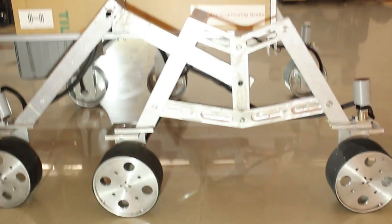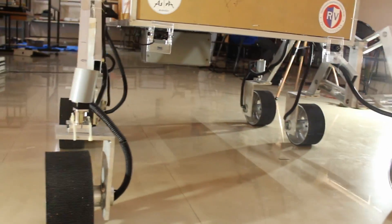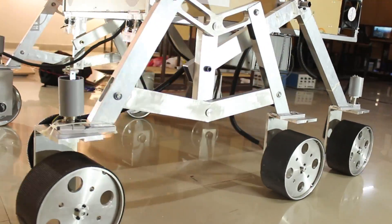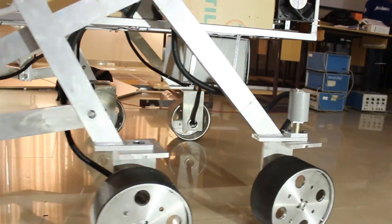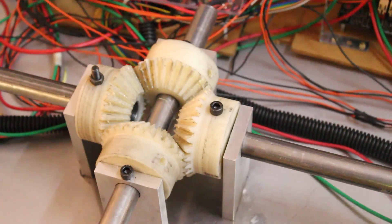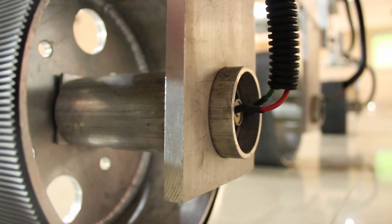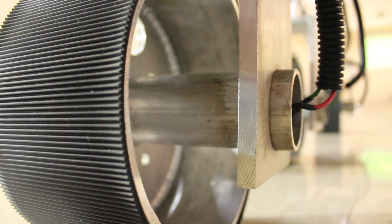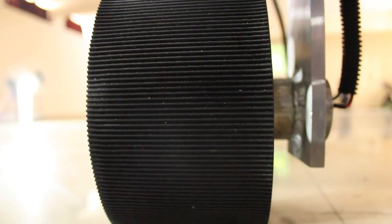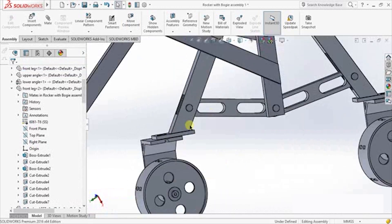For the chassis architecture, we employed the double lambda implementation. We used commercial grade aluminium of 6000 series. The entire chassis was built using rectangular hollow shafts and slabs. The hinges and linkages have been strengthened with tempered steel and small bearings. We have introduced an N differential into the system which uses 4 bevel gears. The motors are housed inside the wheels, enclosed with aluminium sheets for protection from rugged terrain. The wheels are ring rolled with a diameter of 200 mm and covered with rubber mouldings to improve traction. The entire design was made using SOLIDWORKS and the individual components were tested using ANSYS.